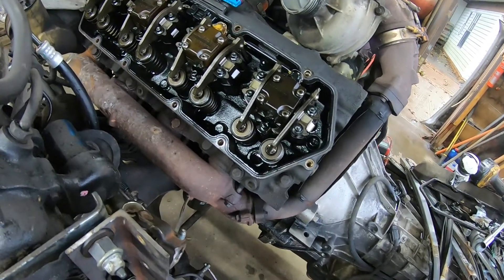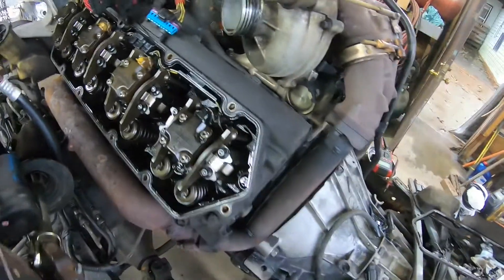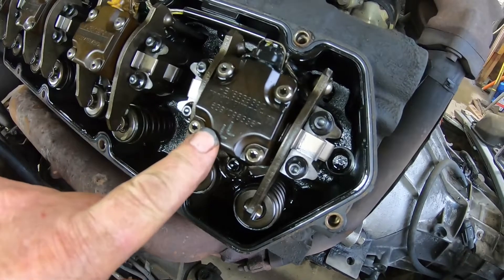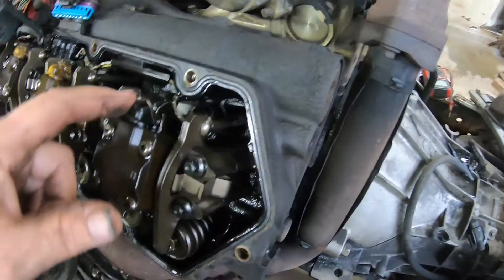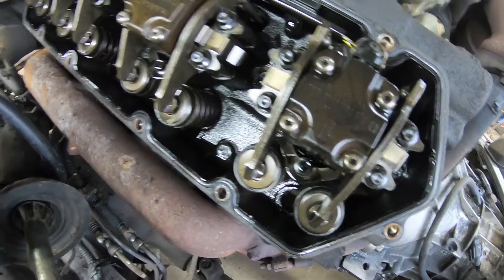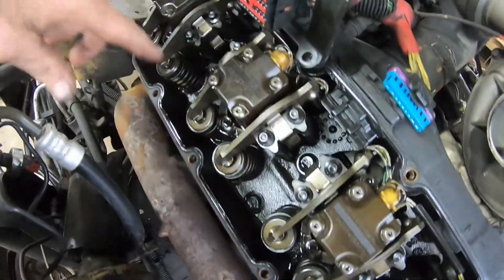These connections are perfectly clean — I don't know if this thing has ever been gone into. You can see it does have the long-lead injector on number eight, and I see it's a different color for that too. I haven't really looked at it; I've got to clean them up. That's A, D, A, D, A, D — so it looks like stock injectors, which is fine. I'm not trying to make a whole bunch of horsepower.